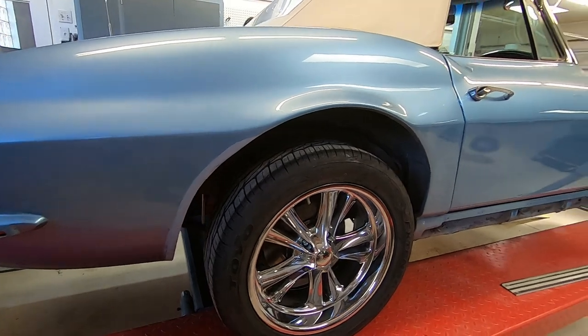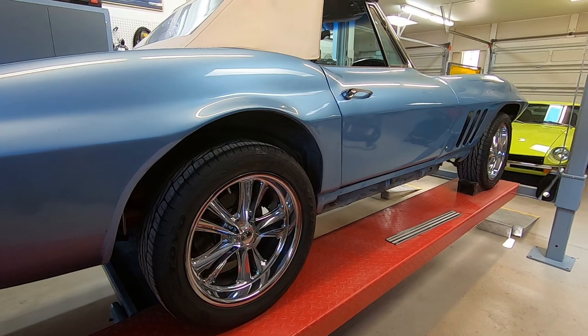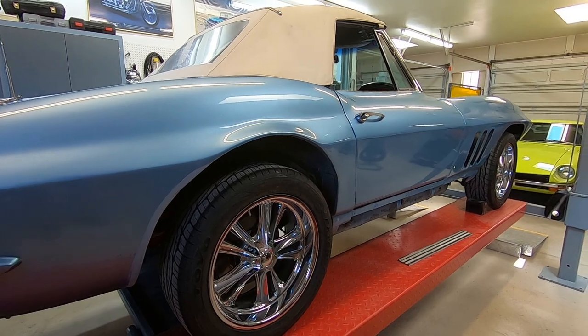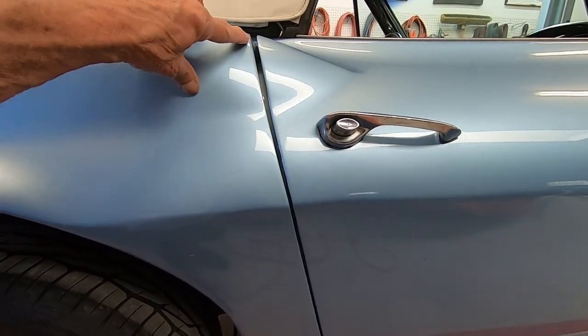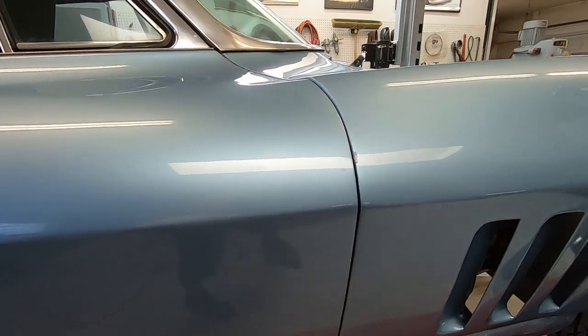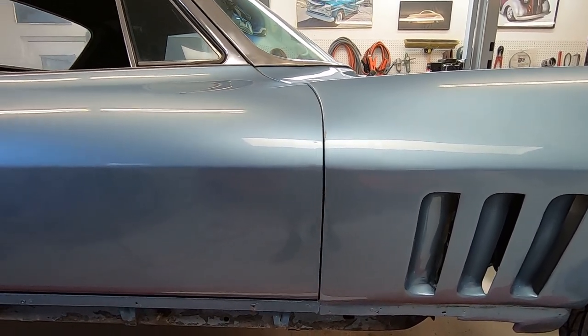Hopefully mine's not too bad because this is a southwest car. But the first thing I'm going to do is try and get some WD-40 on all the threads of these bolts — that might make them a little easier to come out. And one other thing I'm going to do before I pull the body off is measure the gap width between the door and the body, front and back, just so I have a reference as to what it was before I started.